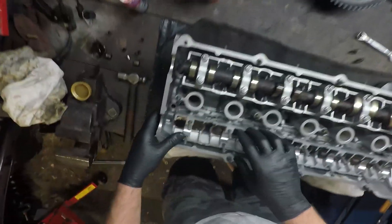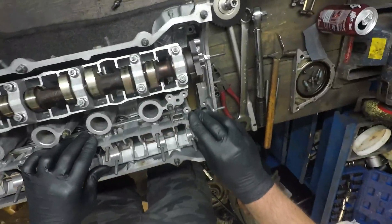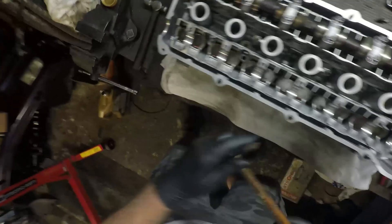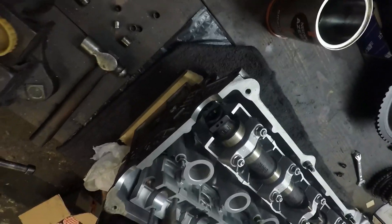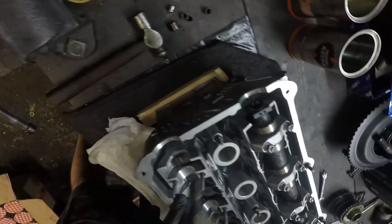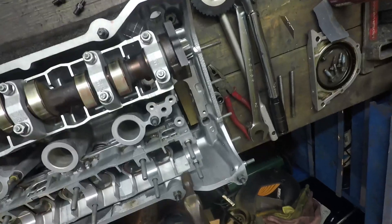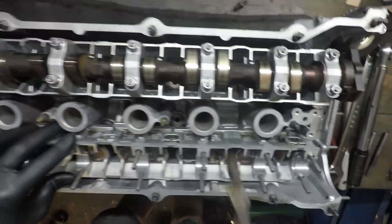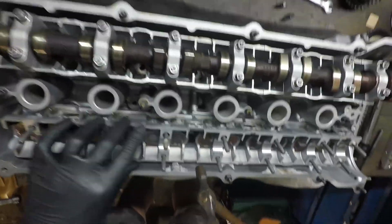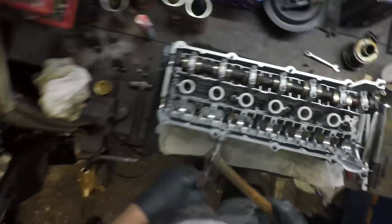So that's it, basically on there. Make sure it's located with the dowels — I'm just getting it slotted in place and then giving it the lightest of taps home with the smallest hammer I've got. There are little locating rings around some of the dowels on the head itself that need to be located on the cam tray so that it sits straight and true. I'm making sure it's engaged in them and going all the way down into the head so it sits nice and flush before putting any caps on.